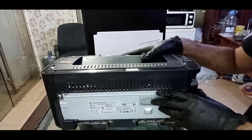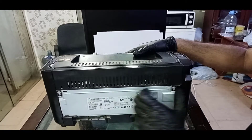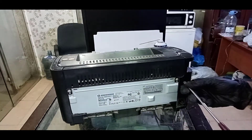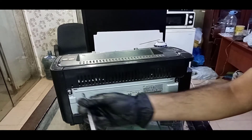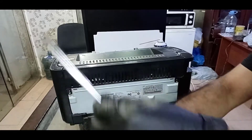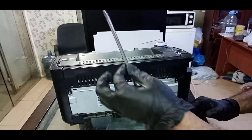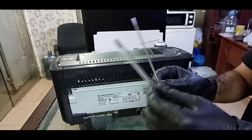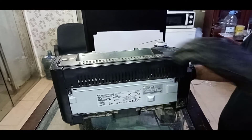First of all you will see here are two screws right behind — we will remove these two screws. Just follow the steps. It's very easy. I will need one star screwdriver and one flat screwdriver, and with the help of these both we will remove the fuser unit.